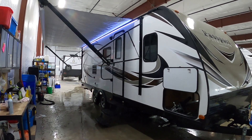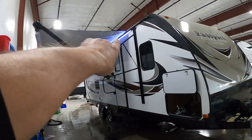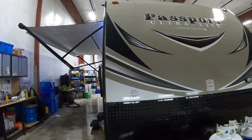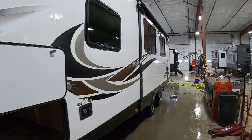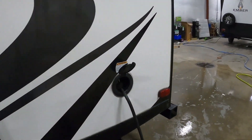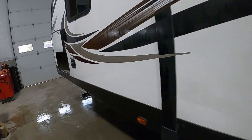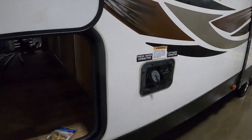Let's start by talking about arriving at the campsite and a couple of things to take into consideration when you're parking. On your campsite side, leave plenty of room for the awning. On your off-campsite side you'll need room for your slide, but also think about where your power and water connections are. Your power is all the way on the rear corner on the driver's side, and your water docking station is all the way up toward the front. Park accordingly so you can utilize facilities at the campsite.